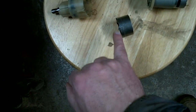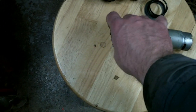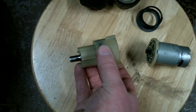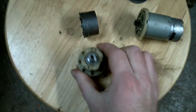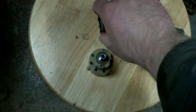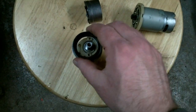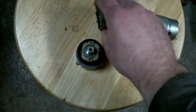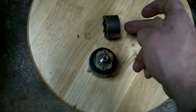What I found out was these teeth — these bumps on this big outer casing — are the heart of the clutch. What happens is the ball bearings go down these little holes and nest against these bumps. The spring and all these washers push the ball bearings down against these notches.